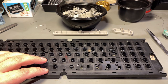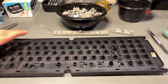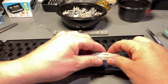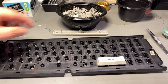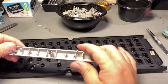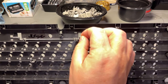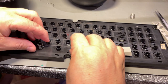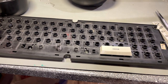It is time to assemble the keyboard. I think it's better to install all the keys before adding the membrane backplate. I'll start with the larger, more complicated keys. The enter key is straightforward, but the spacebar is a little different because it has a metal stabilizer bar behind it. The spacebar has three springs — two are a little bit special and one is the same as the rest.